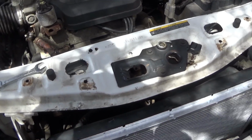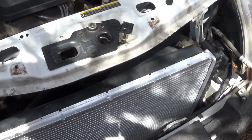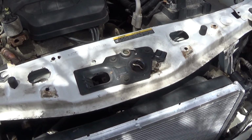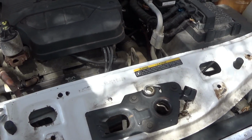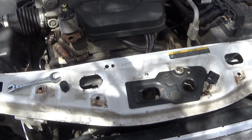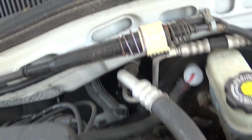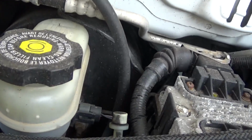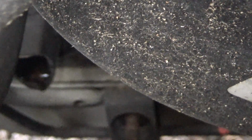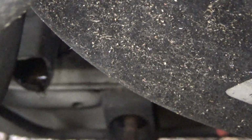I just gotta start connecting the hoses in the back. Put the AC condenser back on. Put some water in here. Give her a jump and see if she goes. Alright, as per owner's request, I started filling it up with just plain water to see right down there. I don't know if you can see very well. That's below the heater core. It's water coming out. Pure water. As I was putting it in, it's coming right out of there.